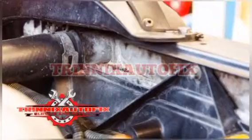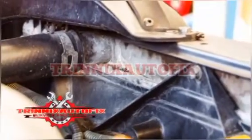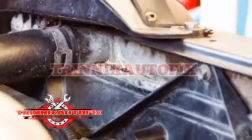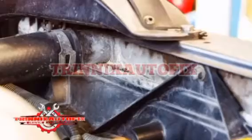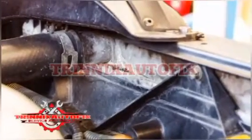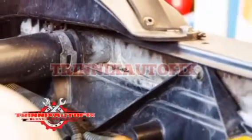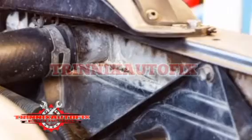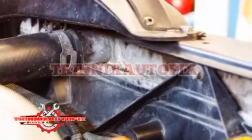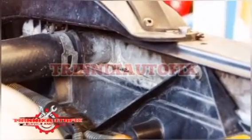4. Coolant system overpressure or overheating. Numerous defects can lead to a cooling system that runs too hot or is pressurized too high. When either of these situations occurs, the hose can blow out and cause a leak. One of the most prevalent issues is when a hose gets kinked. While this won't immediately cause damage, it does reduce coolant flow, leading to an overheating engine. That constant pressure takes a toll on the motor and the hoses. Eventually, something is going to blow, including one of the hoses.